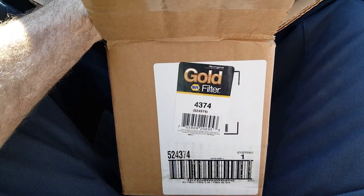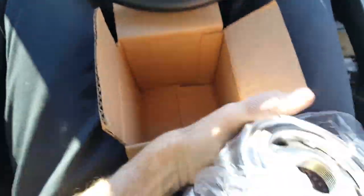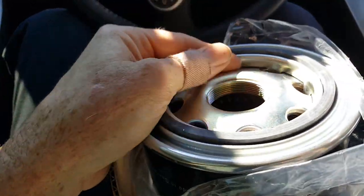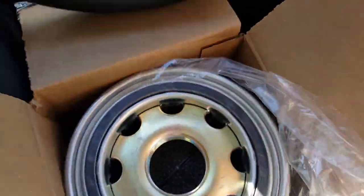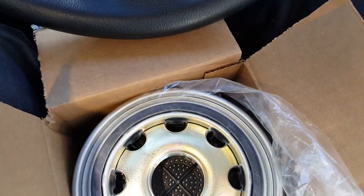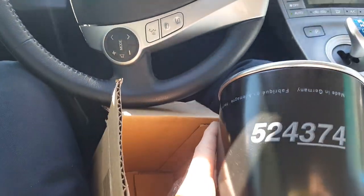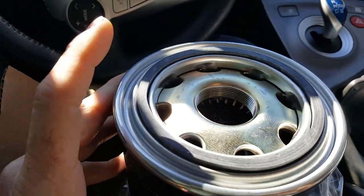Here it is — it's a pretty generic one. I use a NAPA because it's easier to cross-reference. It's a great big heavy filter that just spins on like a normal oil filter. It looks like a big oil filter but it's an air filter with desiccant down inside. The chassis manufacturers say you're supposed to change this out every year, and like I said, nobody ever does that.